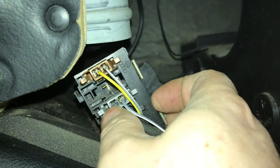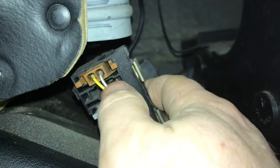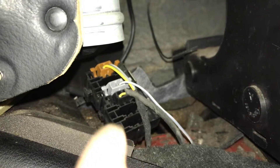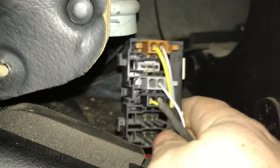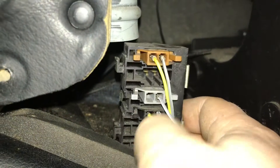The gray wire is probably coming from the engine, one is probably from the ABS, and one is going to the OBD2 plug. The nice thing about this system is if you had other modules — like airbags or other units — you can plug them all in here and they're all connected straight to the OBD2 outlet.